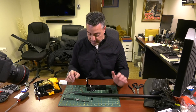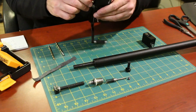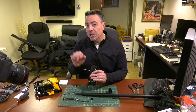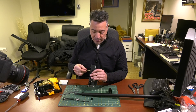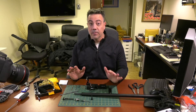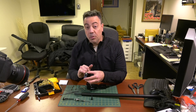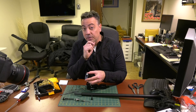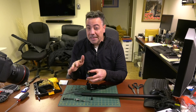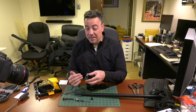We'll open those two up to 3/16ths, and then just for the sake of cleaning it up, we'll pass the 3/16ths into the valve port down here into the block. I can see it goes but not all the way, so it needs a little cleanup in there. I just did a shot string and it revealed that this regulator is currently set at about 2,600–2,700 psi.